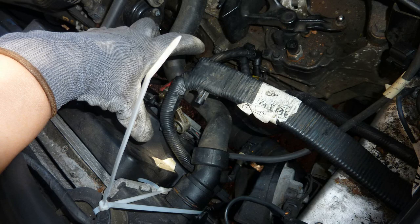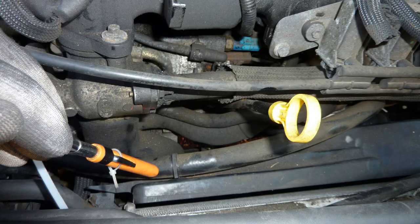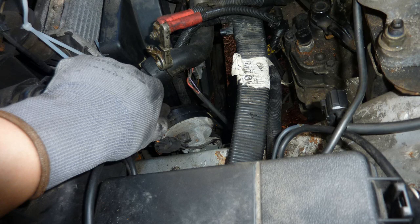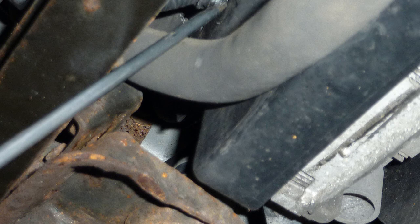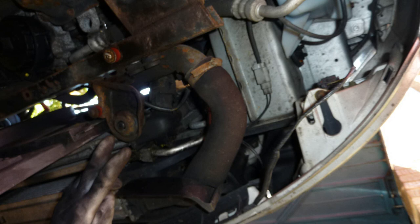Sooner or later, you'll see me finding a fault. I'm showing this as the left-hand side. There's a fault, one of the cables that was causing a lot of smoking. I'll show you, and I'll make a big point of that in a minute, where the cable had come apart. I think it's the pressure sensor for the air intake after it goes through the compressor. My word, if that thing goes on you, even if a cable is frayed or something, it is hell. Your car would just kangaroo, won't go anywhere, lack of power. A tiny little sensor goes wrong on these modernish cars.